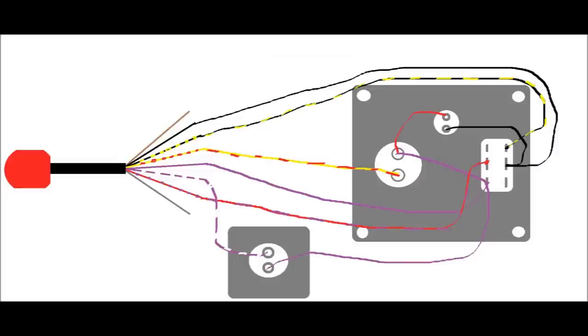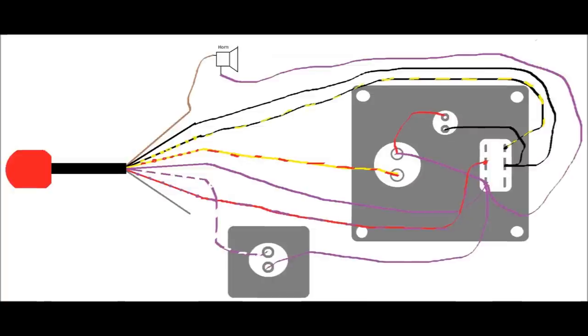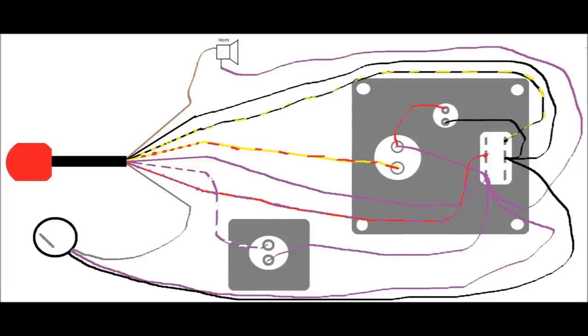Here is a picture of how you would wire in a choke switch — and now you can start and operate your outboard the way you should. You don't have a warning horn, you don't have a tach, but tach isn't really part of the controller anyway so it's not a big deal. I might as well show you how to hook those up: this is your horn hooked up, and this is your tachometer hooked up, should you choose to use one. As you can see, there's a lot of connections going on in this purple switch. This also doesn't give you a neutral safety switch — in order to use that, you're going to have to tap into the one in the controller. You're just going to have to cut the yellow with red stripe wire, run it to the safety switch, and then continue back over to the start switch.